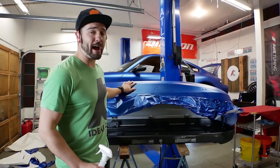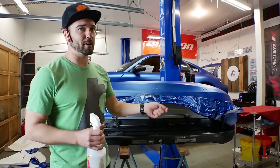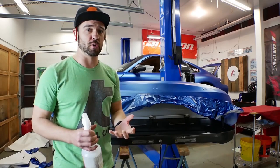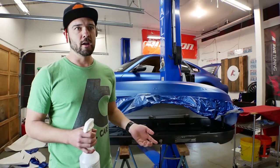Trav and I have finally gotten the whole box wrapped. Now the next part is trimming, which takes a ton of patience — it's going to take just as much time as it took you to wrap the car. You want to be very careful and not cut off too much material. Always remember that this material does shrink with heat, so make sure that every cut is a little longer than you think it should be.